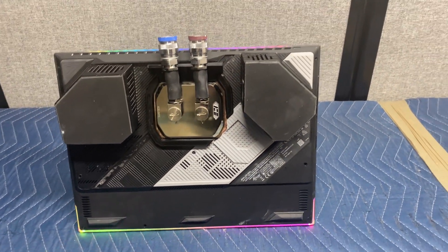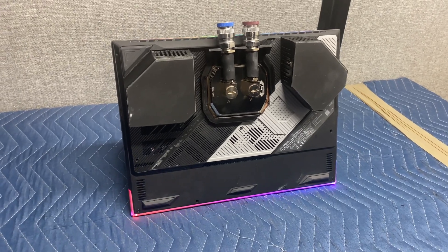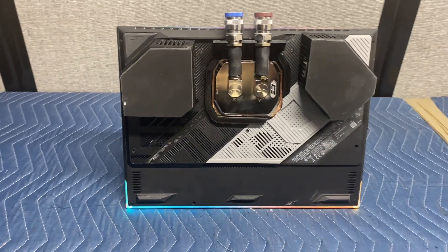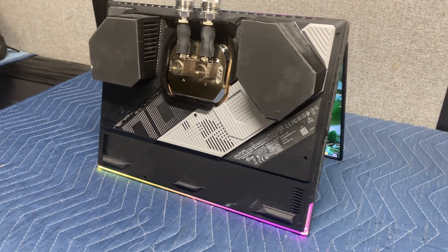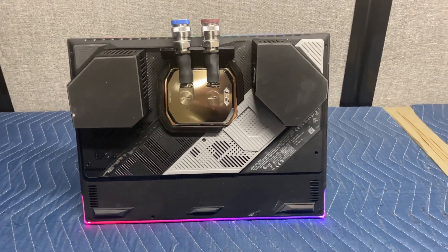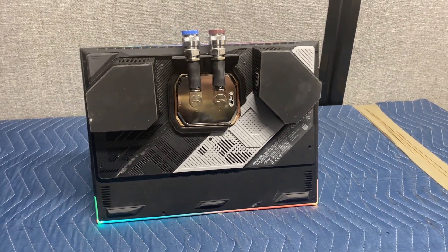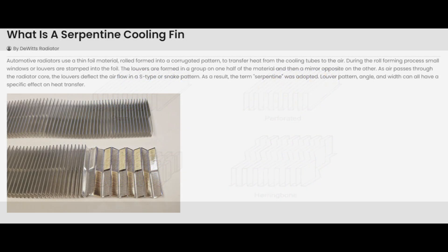After the last few weeks, I've been trying out a couple of different water blocks to see if I can get a bit lower temperatures out of this water cooling system. Looking at the alpha cool block I was using previously, I realized it doesn't actually have any micro fins, which is a pretty big part of how both radiators and water blocks actually help to cool down chips. Micro fins help by increasing the surface area and allowing water to flow through and pull away more heat.